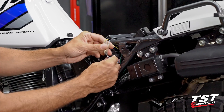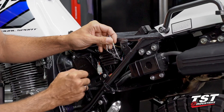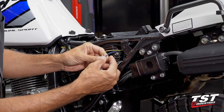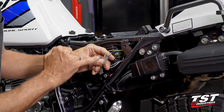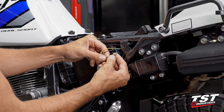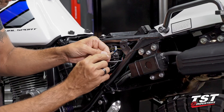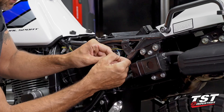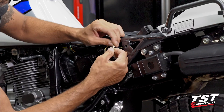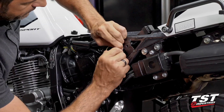Typically on a stock bike the wiring will be just aft of the rectifier. Pull back — the factory connections are gray, black with white trace, and white with black trace. On our tail light system we have blue for running light, yellow for brake light, and black for ground. We have insulators that are shoved into other insulators that accept them; on this side we can slip the connection out.